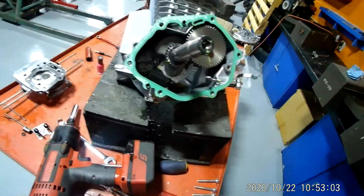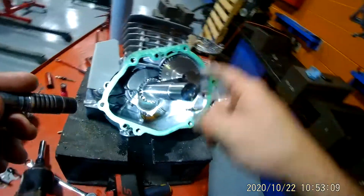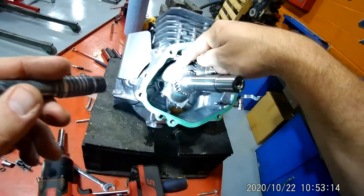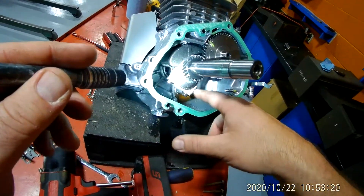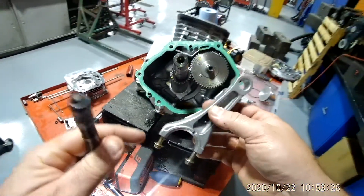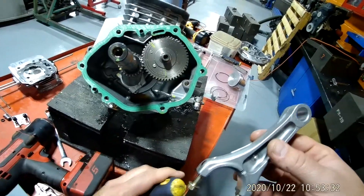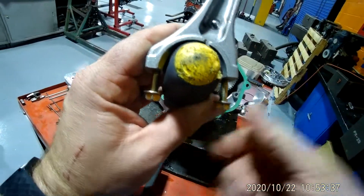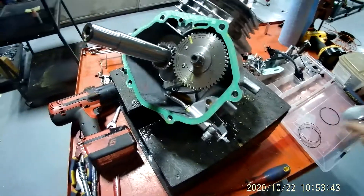The first thing I want you to notice is your crankshaft — this is what the piston pushes up and comes down on. This right here is called a counterweight; it just helps balance the engine so you don't have too much vibration. This right here is a connecting rod cap, which fastens your connecting rod to your crankshaft — so the rod comes up and connects there.